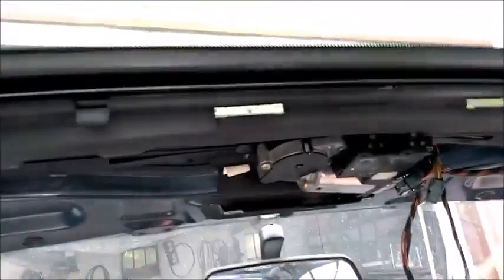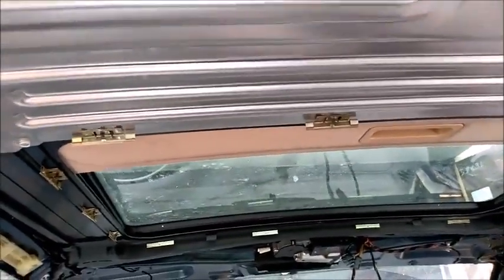Okay, now after the big effort, first we install it in the front pocket, then the clips at the back here, the black ones, you see this one on the other side, and then all over the screws, tighten them up well. Make sure that the glass is going through the hatch well. Plug in the drains, 4 pieces, 4 sides, and then hook up the motor.